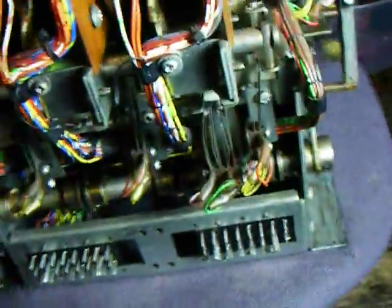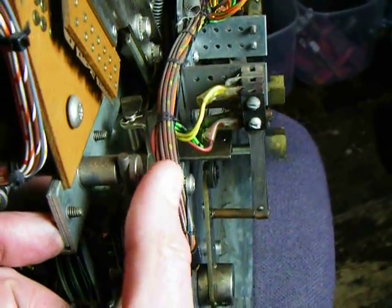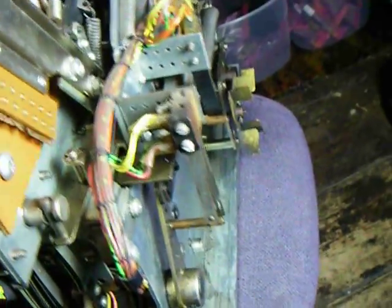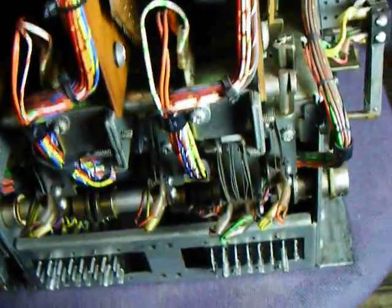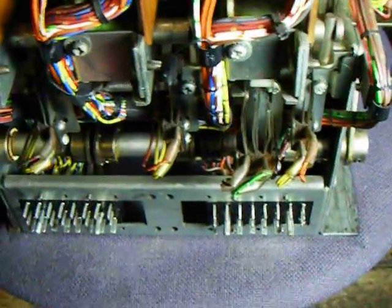This machine actually has hold, and when a hold is actuated, this little solenoid clicks in here and it stops this lever actually being kicked back — it locks it in position. That effectively stops that reel from spinning. There is another solenoid tucked under here that will unlock it by releasing a little bar, and that takes off all the holds, but they'll also reset automatically when the reel is operated.